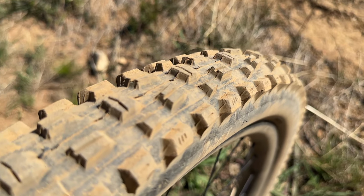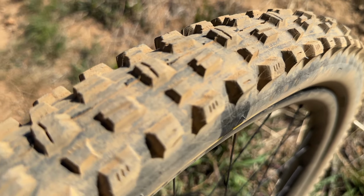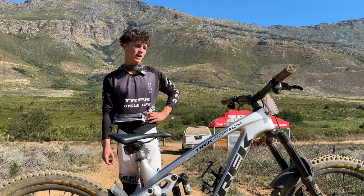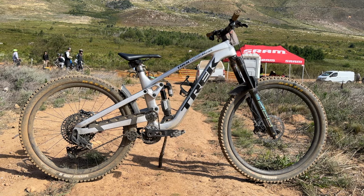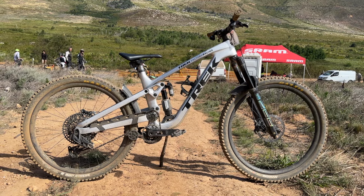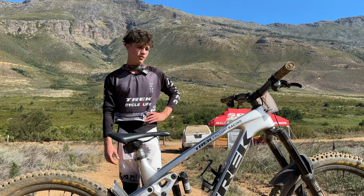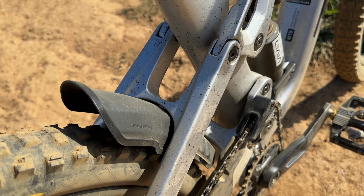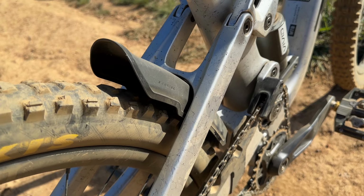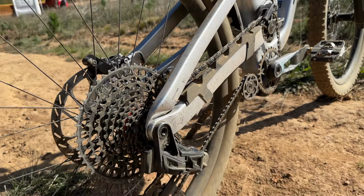And then, right, let's look at tires, tire pressures. So do you run inserts? No, I've tried inserts. The bike felt too sluggish. Too heavy. So you've got DH casing, Maxxis Assegai, Maxxis DHR2. What tire pressures do you run? 20 front, 22 in the back. Do you change that at all? Sparse route I went a bit softer, but any other track, it's usually the same.